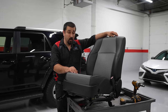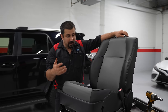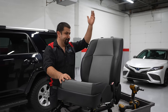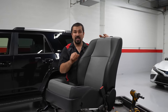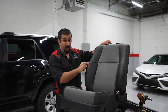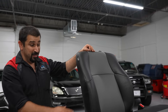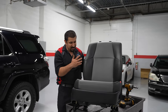Before you consider upholstering, I will say one thing — possibly why this customer considered OEM instead. These seats have airbags. Nothing against upholstery shops, but not all of them actually want to deal with seats with airbags. The bottom doesn't have airbags, but airbags are still involved. Don't go modifying your seats and expect the airbags to work right — be careful with airbags. Good upholstery shops will tell you they need to charge significantly more to do this the right way, because this seam on the side has to be sewn in a way that it will open up and allow the airbag to come out. Otherwise the airbag could pop from somewhere else if you use high-quality thread that won't penetrate. So be careful with seats and airbags.